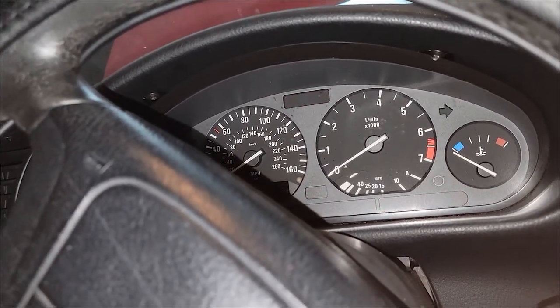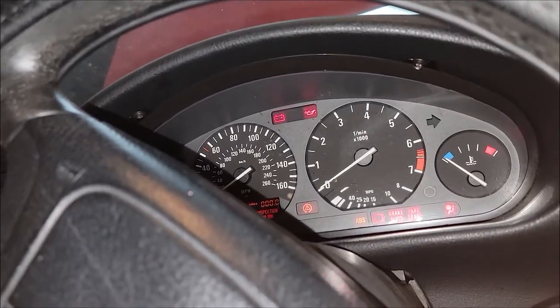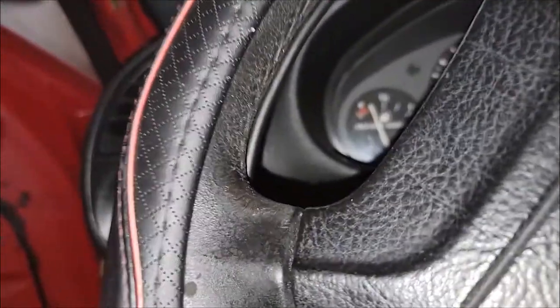That's a little weak crank - I know the battery's charged. It started! Let's go, that's all I needed to hear. I'm a little hesitant to let it actually run because I know there are some major vacuum leaks - I've got the idle air control valve unplugged and that's a massive vacuum leak. But that sound, it kind of sounded like it did have low compression. So once I do get it running, I'll do a compression test and just cross my fingers. But so far, that's a good sign. Now I'm wondering if it's just not getting enough fuel, but the fact that it did start at all tells me it is getting some fuel. I guess we'll investigate a little bit and go from there.